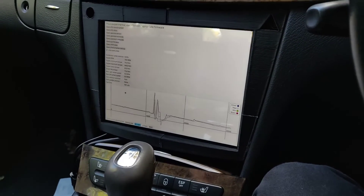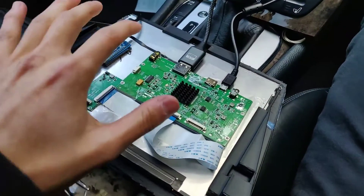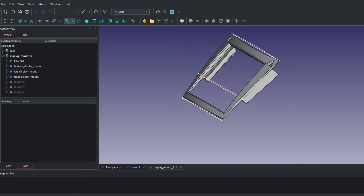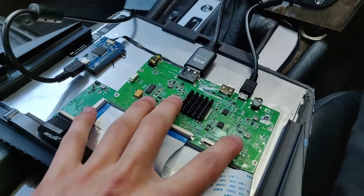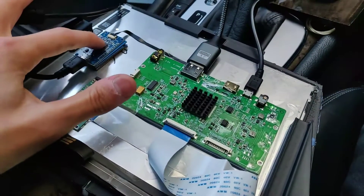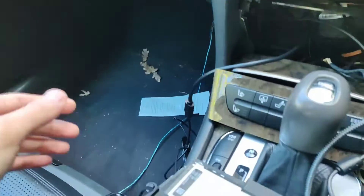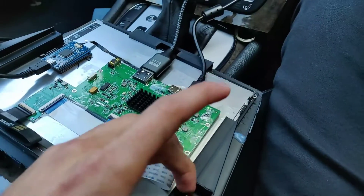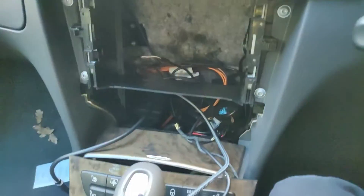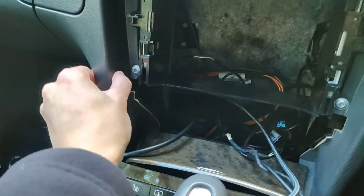Let's quickly turn the engine off — apologies for the focus there. I'll show what the back of this module looks like. I've managed to take it out — I couldn't do that on camera because it is really delicate. The 3D mould I have — I'll see if I can put a video of the 3D CAD file on screen — it's got supports here for the side of the screen and support for the bottom of the screen, which doesn't interfere with the touch cable. I've got mounting for the HDMI board, the backlight driver board, and the touch input controller. The touch input goes to that USB breakout there. I want to mount that somewhere like inside the glove box or maybe in the ashtray compartment when I'm done. I'm still working on the next revision of this board, which will have a back plate that slots on where the old command module used to be, so it has more support for holding itself in the car. Right now it does fall out a little bit — there's a temporary fix where I've put some hot glue here, so it kind of presses on the walls to hold itself in place with friction.